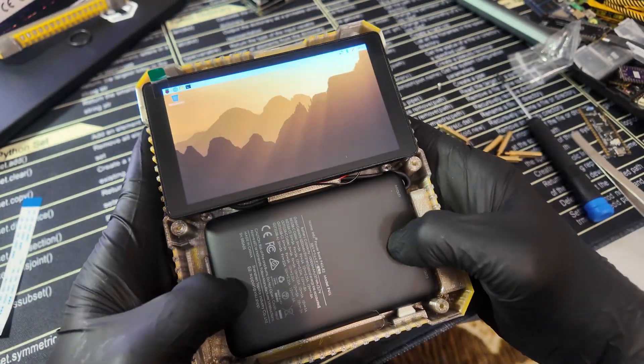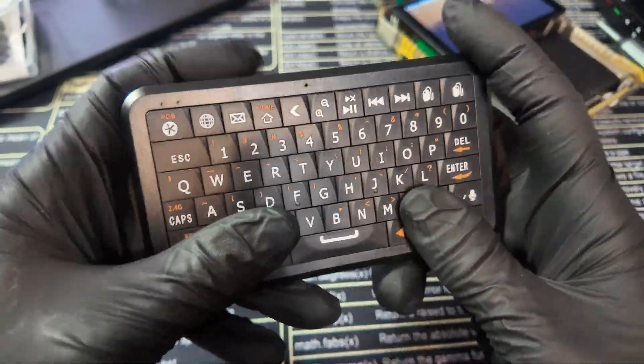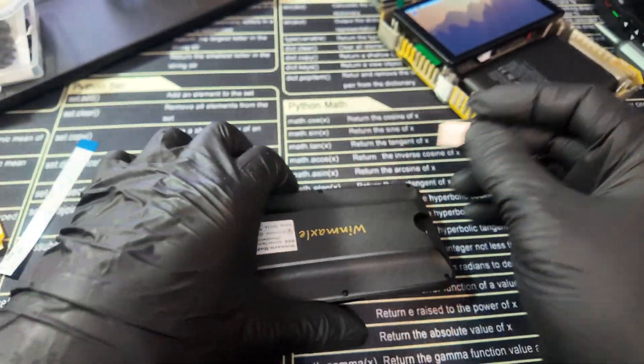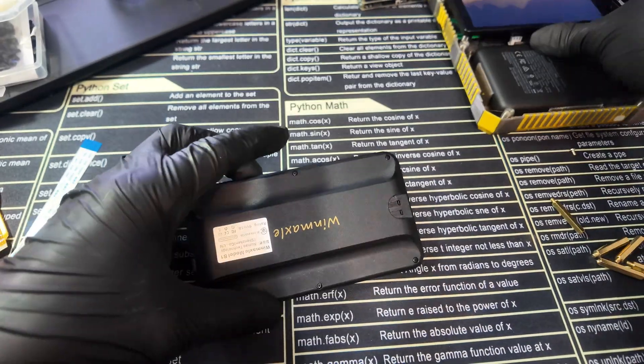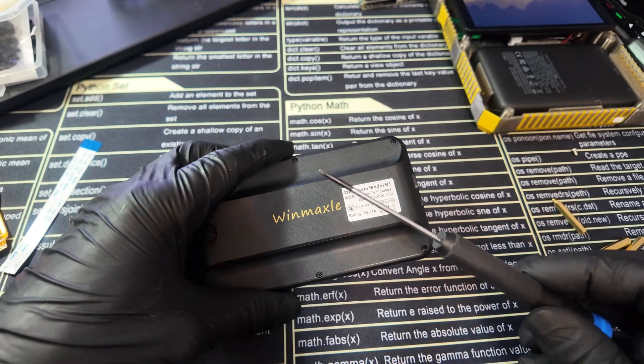Now we can install the actual keyboard. While disassembling the keyboard, pay close attention to the on/off switch — don't accidentally lose it, especially on carpet. The keyboard is very clicky, feels amazing; it has an air mouse, a built-in microphone, and RGB. Take out the 2.4 GHz dongle first and plug it into the USB 2 port of the Pi 5 so we don't lose it. Then unscrew all six screws on the keyboard with a Phillips head.